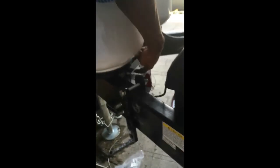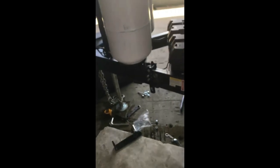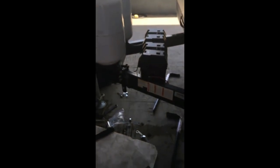It runs constantly on this 12 volt battery, so when you go to store the unit away, if you don't want to come back to a dead battery, shut the battery off, which is over here. This is pointed up, it's labeled on and then off. If I go down, I can actually pull the key out, now it's off. Turn it back on, it's in the up position. Oh, the nubby side is on. Okay, I got you. That's important because that'll drain your battery if it's stored away for a week or so. You don't mess with it, all right?